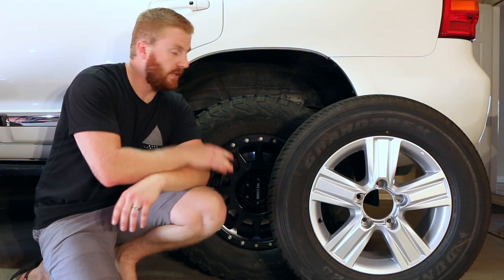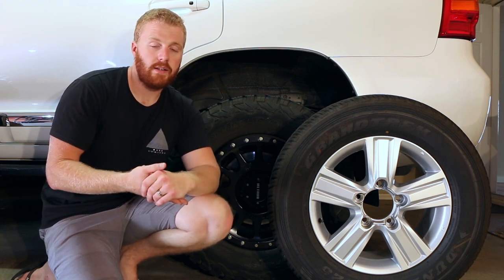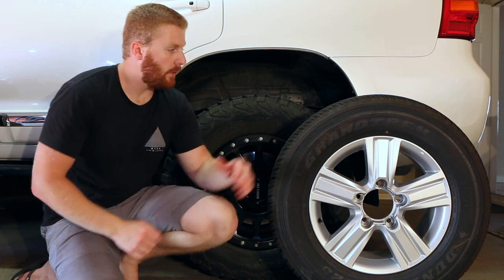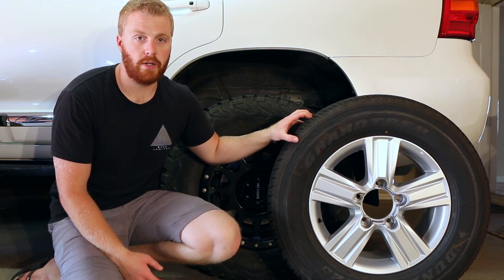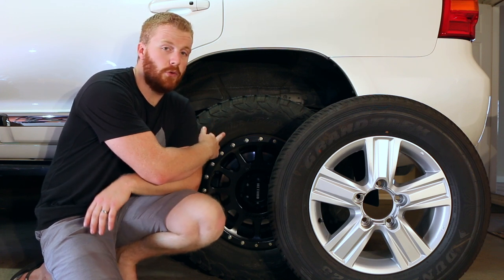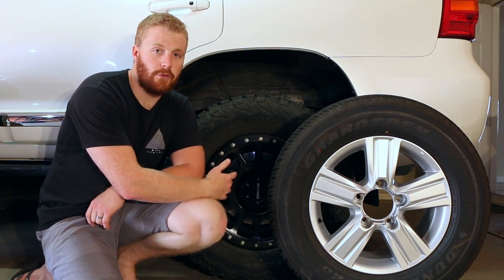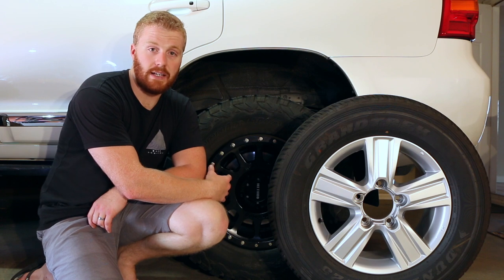The last thing I wanted to touch on with these wheels is weight — specifically unsprung weight. It's not a weight that you always consider when upgrading suspension, but these wheels and tires do add a significant amount of weight to your vehicle. When you look at the stock wheel and tire combo, per tire you're looking at about 34.2 kilos. Compare that with the BF Goodrich rim and tire we're running — it's 43.6 kilos. That's a significant increase in weight, and obviously we're carrying five of them including the spare. So overall you're looking at a difference of 47 kilos just in your wheels and tires, which is fairly significant when you're running a heavy car like we are.